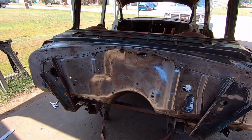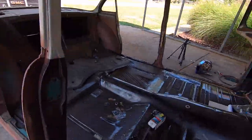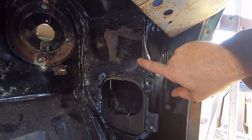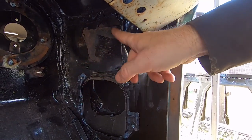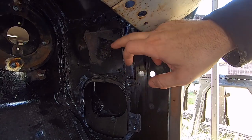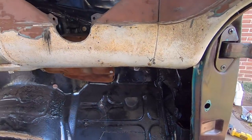Anyway, that's pretty much done. This car was a standard heater and I'm putting in a deluxe heater. Standard heater cars have a block-off plate with four clutch head screws. If you're going to put a deluxe heater in your car, you need the little flange bracket that screws on and has a lip on it for a seal. I do have this piece - I got it from a friend who had it on a parts car - so I'm converting all to deluxe heater.